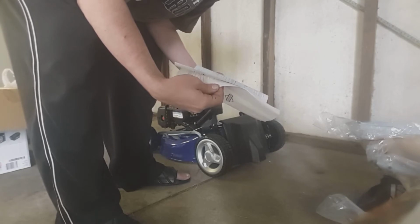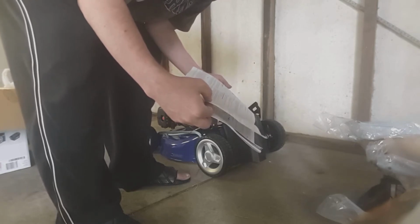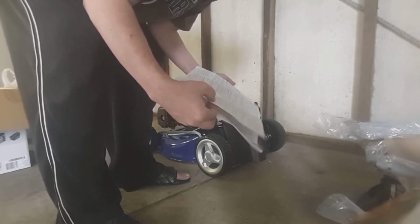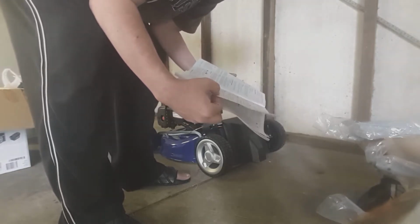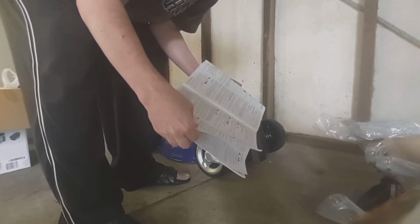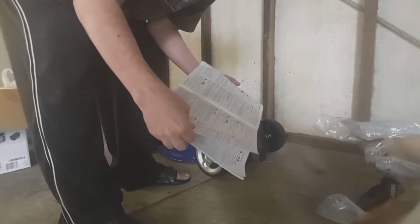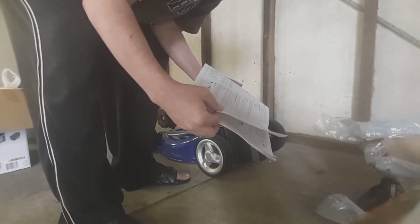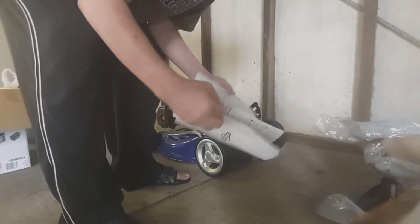Anything I should know? Oil recommendations. So we could do with an oil like Vanguard Synthetic 15W-50, just because it does get that hot. It pretty much covers from negative 7 to over 49 degrees Celsius, which is over 100 degrees Fahrenheit. There's others, but I won't go into that because we're in Australia and it doesn't get that cold, nor does it stay within a set temperature range.